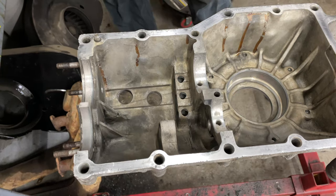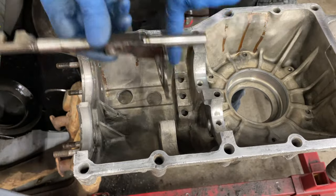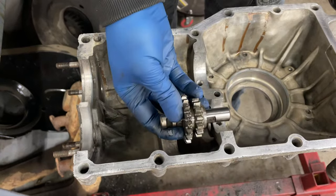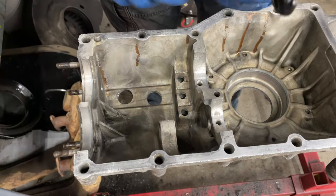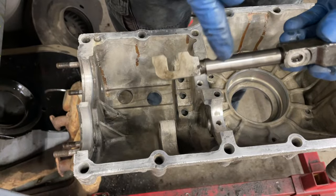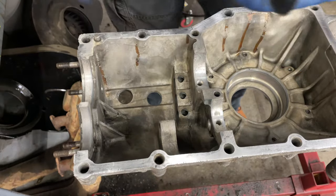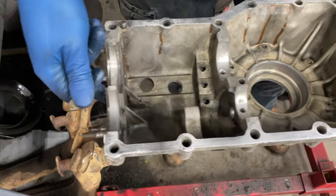All right, I think I have an idea what's going on here, so I'm going to do this guy first. It's got a little hook up here and it sits at the top of the line, and this is used in conjunction with this guy that goes up here as well. I'm doing this because it's at the bottom of the row. This tilts downward like that, and I think it's going to allow me to get those oblong detents in. So Nancy does talk about this, and what she's saying is that these are used as a lockout to allow only one of these rods to move at any given time instead of more than one. I did have to unbolt this in order to get it out of the box.